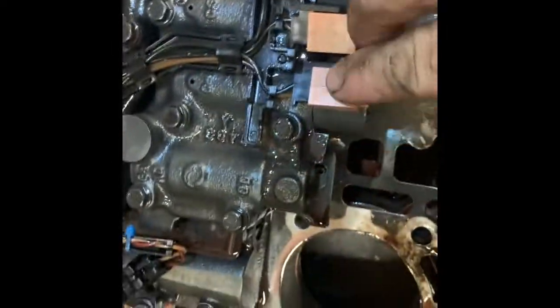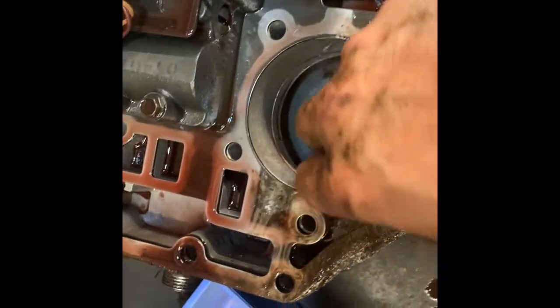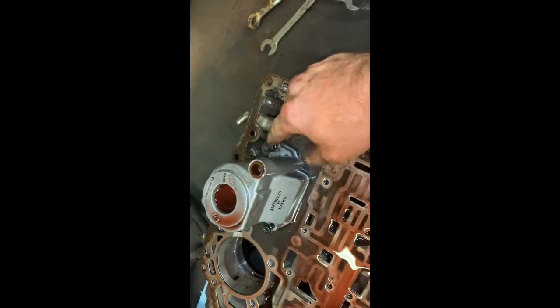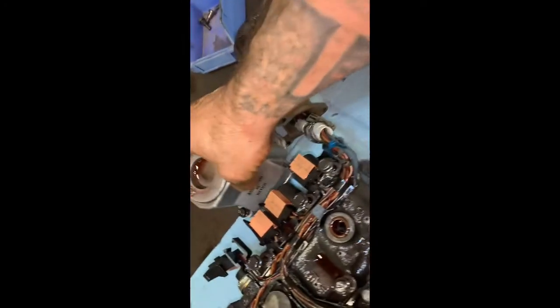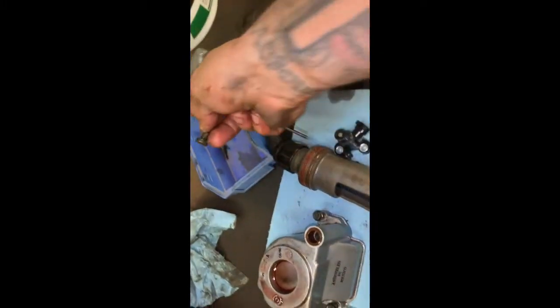This valve body needs to come off — these are your solenoids. Here's your turbine speed sensor connector; there are two bolts to take off to get that out. These seals get replaced. There's a gasket on top and another gasket below this plate. Once you've got the solenoid block off the module, take these three bolts out and remove your filter. Then take the three bolts out of the harness tower and you can lift this plate up and replace the gasket underneath.